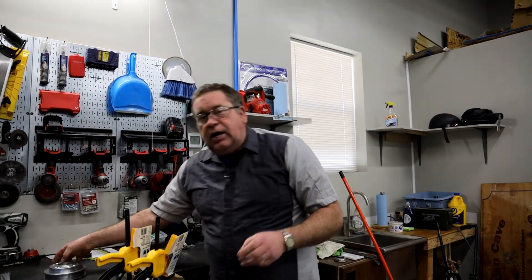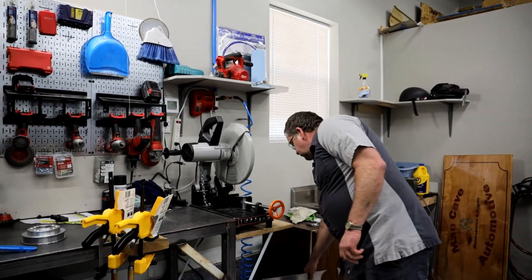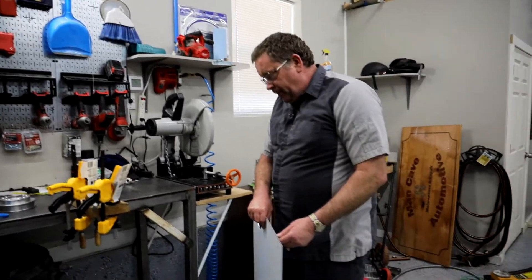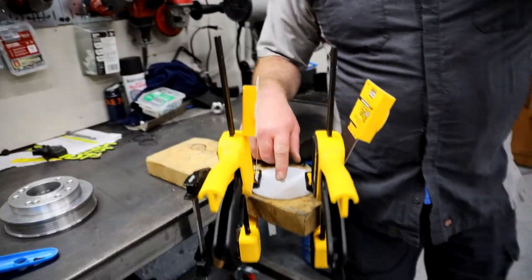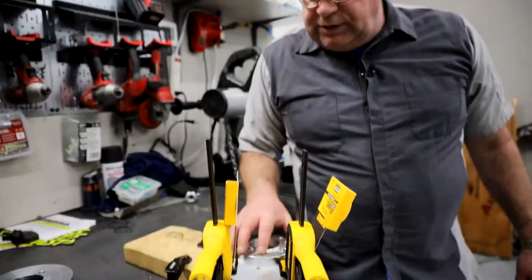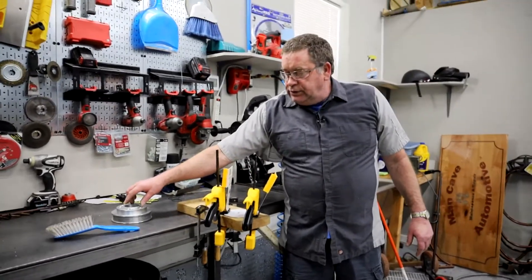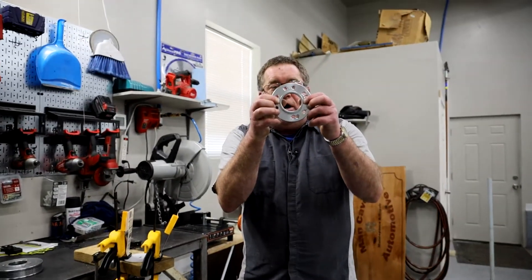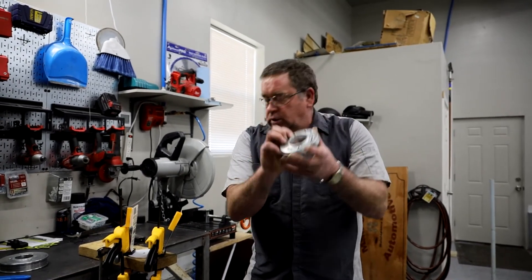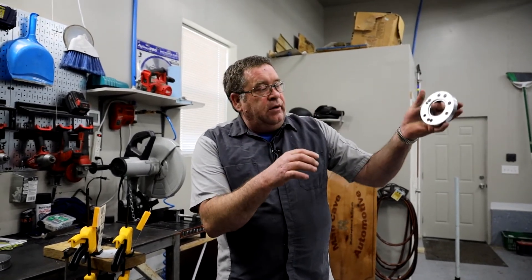I am in the process of the last step of this adapter. What I did was I took a piece of quarter-inch aluminum and cut out a piece of that aluminum using a four-and-a-half-inch hole saw — that is the same size as this adapter. I am going to cut this out a second time using a two-and-three-eighths-inch hole saw, which is the same size as the outside of this flange right here, so that will set directly on top of this and space it out from the harmonic balancer.